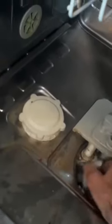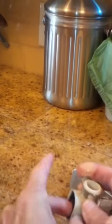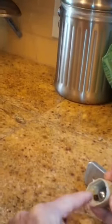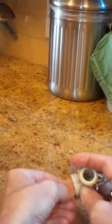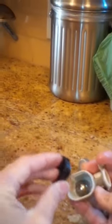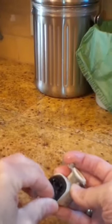If something is caught in there, it would let water flow back in from the drain tube. We're going to reach in and pull out this little rubber piece. Inside we find the ball bearing, but also a little cherry pit. The cherry pit was stuck in there, keeping the ball bearing from sealing down on the rubber. We got that out, put the rubber piece back in — and that's why there was so much water left in the bottom.